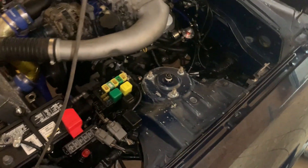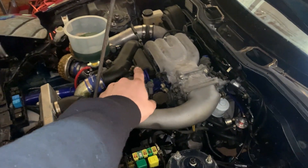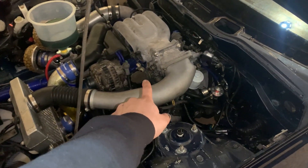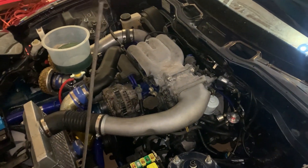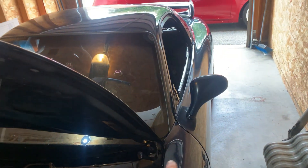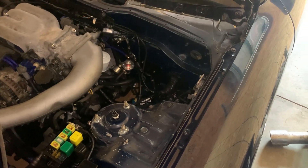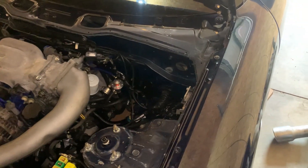Other possibilities: a bad regulator, a leak somewhere in the system — probably in the fuel tank off one of the lines on the fuel pump — or a bad fuel pump. So possibly an issue with the entire fueling system. I'm going to pull the injectors off, get them cleaned and tested, pull the fuel pump out, check everything, put it back together and test it. If it's still having issues, I'll replace the regulator, and if still no fix, I'll replace the whole fueling system.